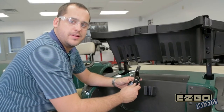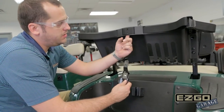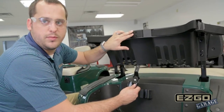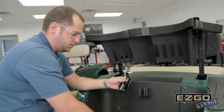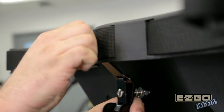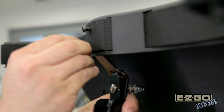Now we're going to go ahead and install the upper tow bar retaining bracket. To do that, we're going to insert the bracket behind the sweater basket bag straps through the two holes that we left when we removed those push clips earlier. Now we're going to go ahead and insert the hardware through the two holes. We're just going to get them finger tight for right now, because we're going to have to adjust everything later.